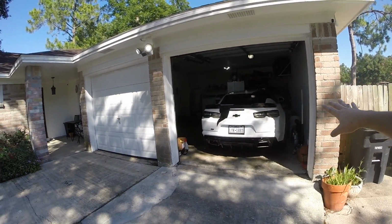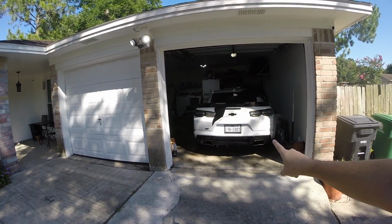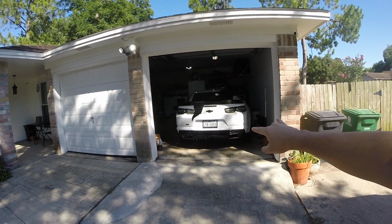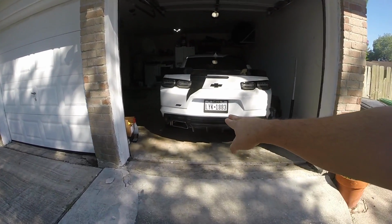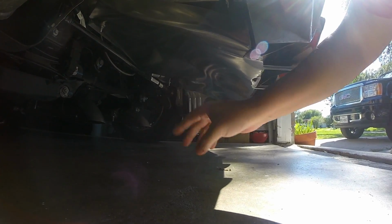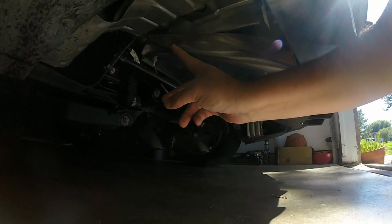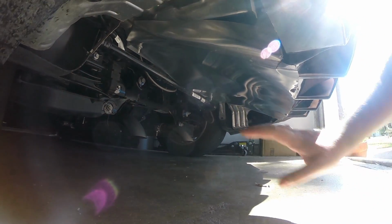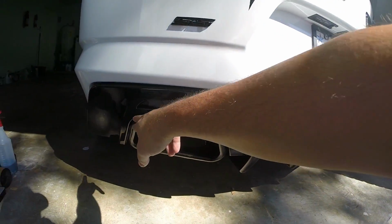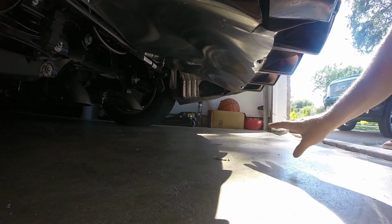But you guys already know we've got the car ready to go, and a lot of you in the comments mentioned that removing the rear muffler was going to cause some extra drag. I'm going to show you guys exactly what I did to reduce that and not have this rear diffuser's middle section acting like a parachute. If you kind of see under here, that's right, I have basically installed an aluminum piece of sheet metal bolted right onto the diffuser and the top end back there with the stock factory bolts, and this basically has now covered the cavity of this middle section that a lot of people just end up cutting out or doing stuff to prevent that air brake, and will be guiding the air down under that diffuser.